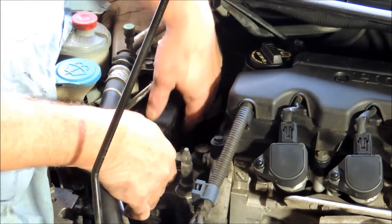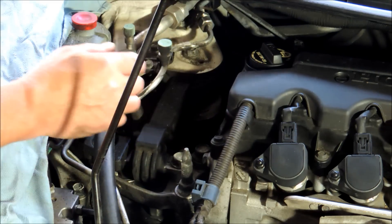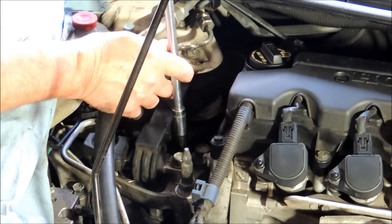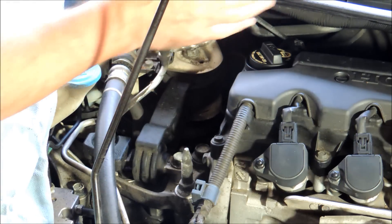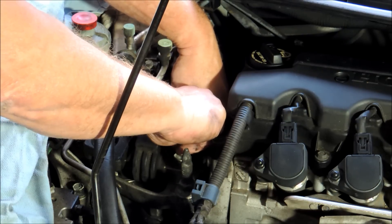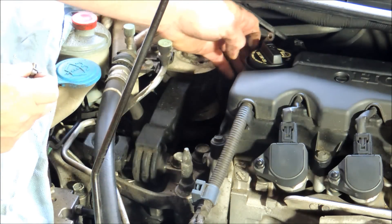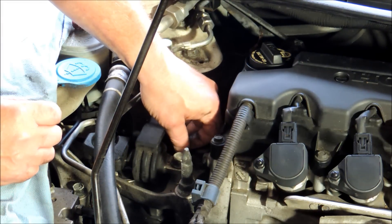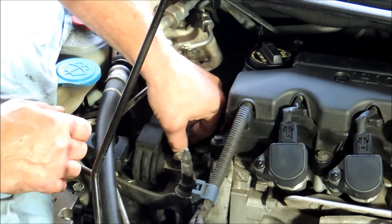The first thing I want to do is get this rubber dog bone off — it's in the way. We've got to get below it because the major motor mount is down here; this other motor mount is not your issue. I'm going to take my 3/8 ratchet, extension, and 10 mil socket. Right down here on the other side of the big nut, you're going to see a ground wire — a little skinny thing — and it's a 10 mil bolt. Just loosen it up. Like all good Hondas, the bolt shouldn't break, it should come right off. Push the ground wire out of the way and put the bolt right back in its hole so you don't lose it.